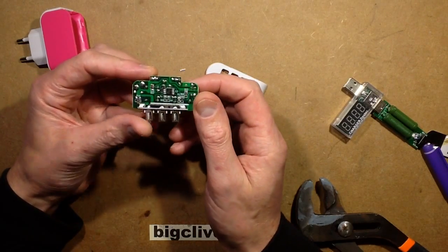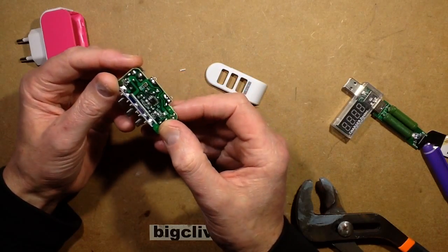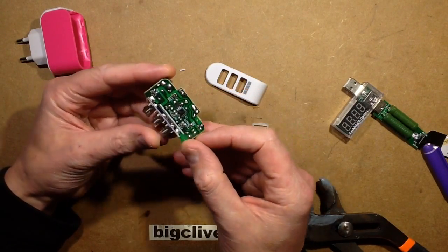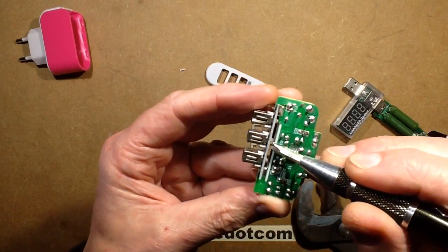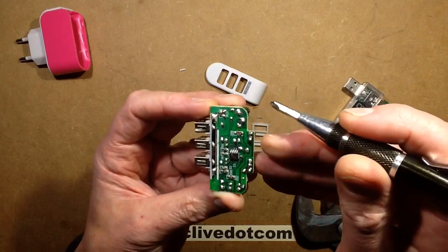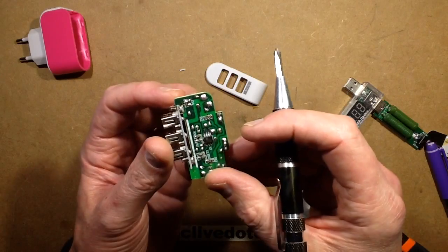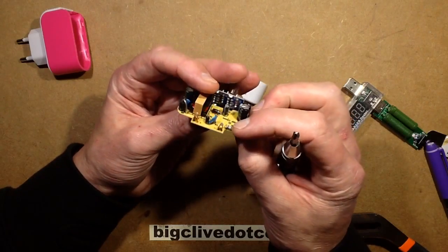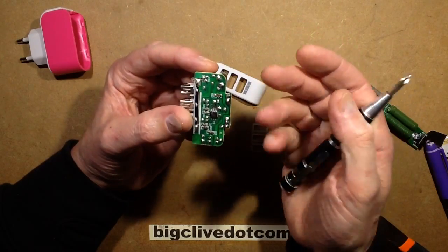Let's take a look at the isolation to the output, which is not overly clear. The isolation is this white line here, which then goes up here, round here, over here and over there. It's not very good isolation — it's not the required distance. Safe products need proper isolation. It's more than a millimetre for most of it, which is better than many.